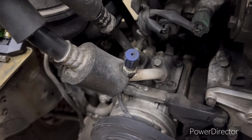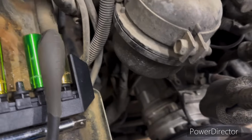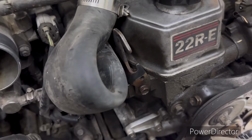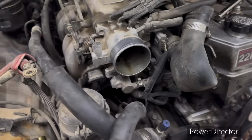But I'm gonna go get my tools, and we're gonna take this air conditioner pump, loosen those 4 bolts. We're gonna take it off and lay it over here safely out of the way, because we don't want to lose the Freon and have to get the system recharged. It worked last time. Keep your fingers crossed. Let's hope it does again.